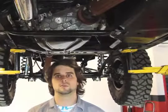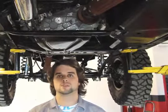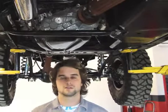We're going to get into it here and take a look at our cat-back systems. So we start up front here — our cat-back systems are all bolt-on. The stock system is removable; basically you take it apart in pieces, it comes off, and then our system starts at the factory Y pipe. It's two and a half inch stainless steel mandrel bent, and then we go into our muffler.